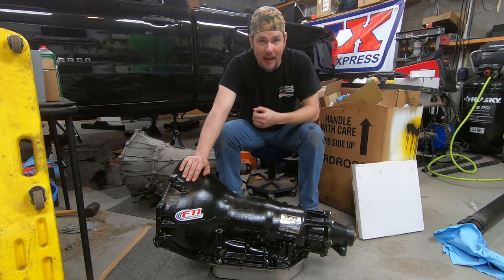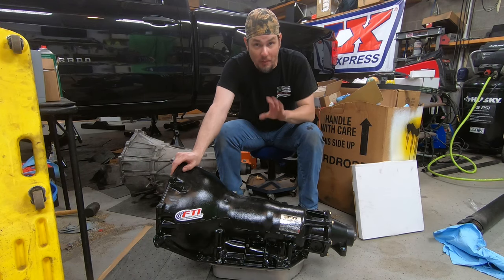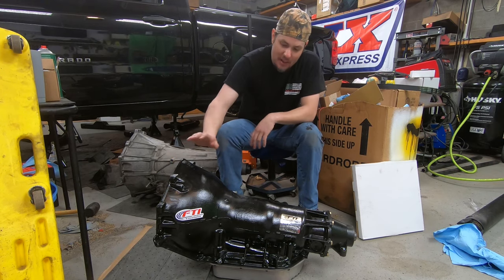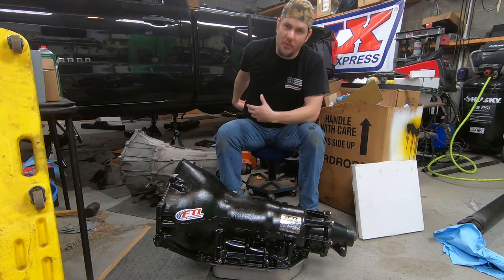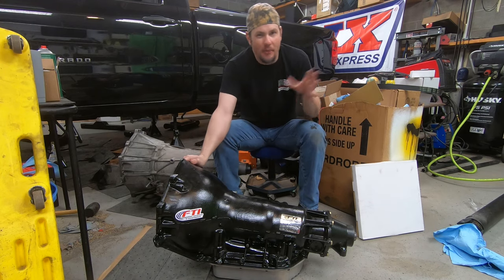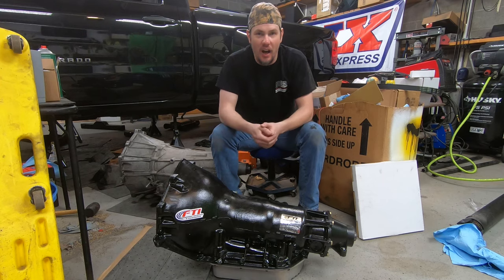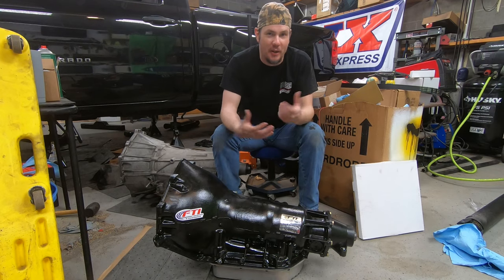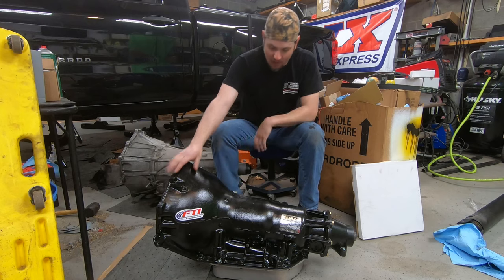You also need to think about transmission cooling. Instead of reusing the factory unit in the radiator, we're going with the Derale remote mount cooler. I'm putting it in the back underneath the bed - it has its own fan and thermostat, so when the temperature reaches 180°F it automatically kicks the fan on and draws air across it. You can wire it for push or pull. I'll throw a link below - it's the mid-tier model, not the cheapest but not the top-end dual-fan units that can run four or five hundred dollars.